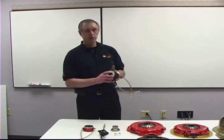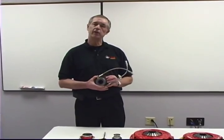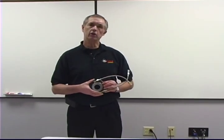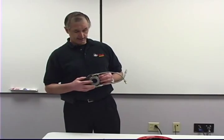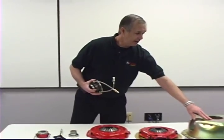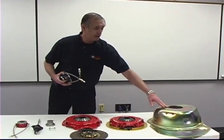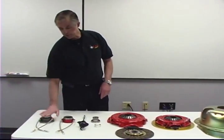This will give you more clearance. This is what you would use on Chevrolets because they use a four-speed bell housing — it's not deep enough. And also on the early Ford four-speeds, your top loaders and T10 transmissions that were used in Fords. If you've got more than three inches of clearance between the back face of the bell housing down to the fingers, you can use a slip-on bearing. If you don't, you have to use a bolt-on bearing.